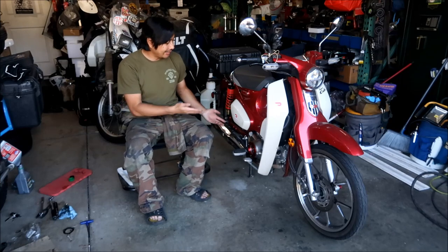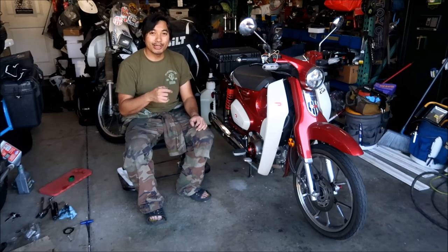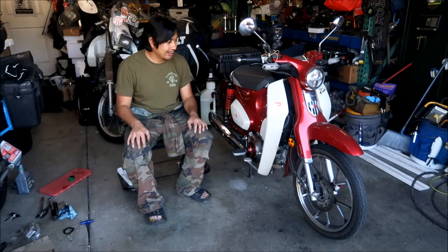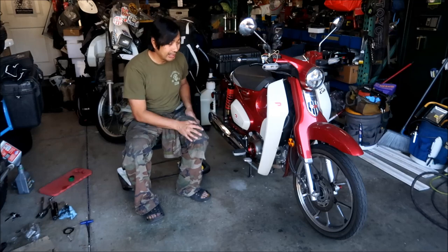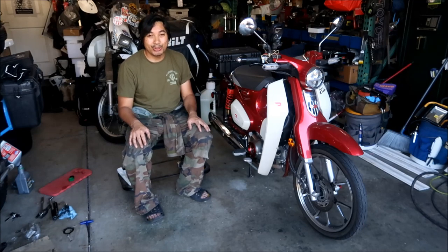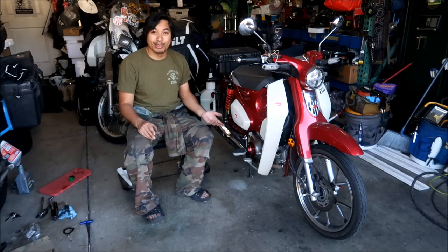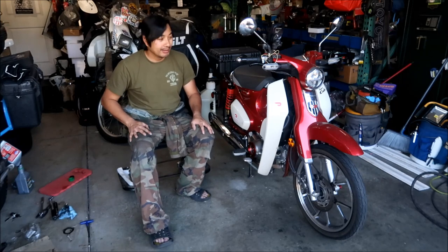So, we're done. What I did is we changed the oil strainer, we took the oil spinner apart and cleaned up in there, and I changed the gasket because I had a brand new one, and I cleaned up all around there. We put it all back together. So what I did is I put it on its side first — everything is going to fall apart if you don't put it on its side. What I used is a mat and a moving blanket. My suggestion is just use a bunch of blankets you don't mind getting dirty. You do need some space — I barely had enough space in my garage. It took me four hours to do it; I was kind of taking my time just to make sure I was doing it right.